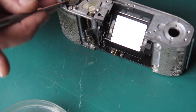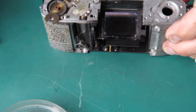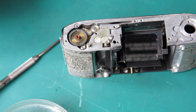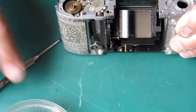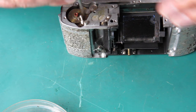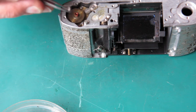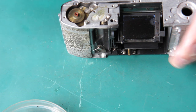So we can lift this piece out. That's very yellow looking — that yellow color is oil, oil and grease. The little drive gear can come out. There are two screws: one that holds this little ratchet pawl in place, and the ratchet pawl's return spring, which I'm going to remove and carefully put to one side. There's the spacer and there's the little pawl, and that just stops the film advance from rolling backwards.